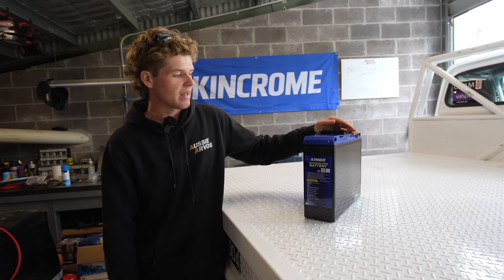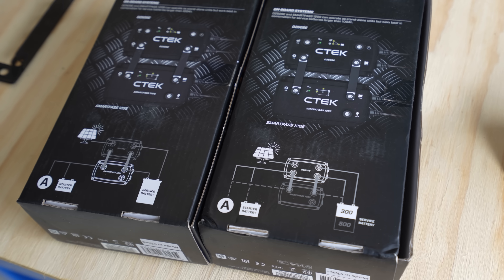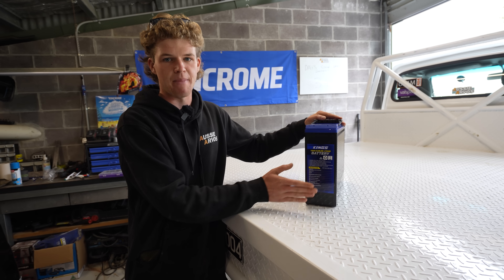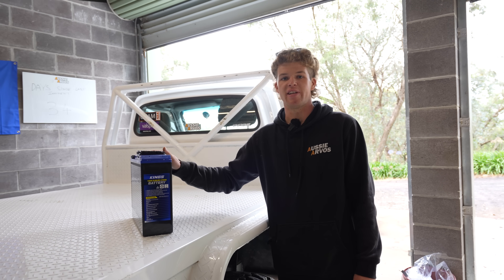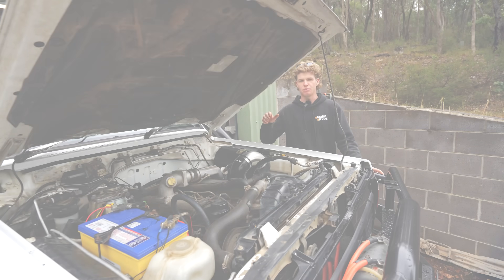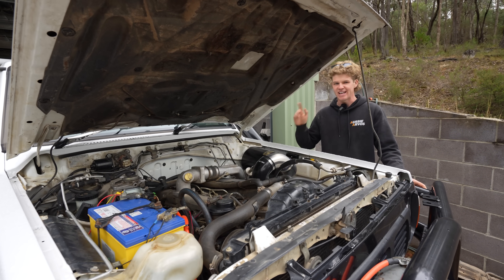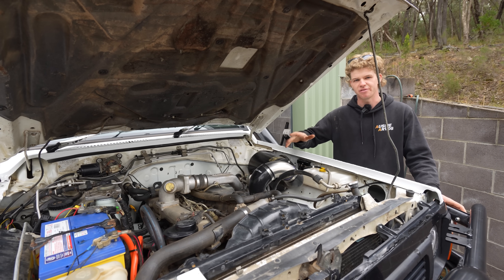We're going to fit this thing up — we've got a few more things as well, chargers and that, and some pretty cool charging systems happening too. But the first step is to figure out where this thing's actually going to mount on the car. My biggest consideration was where on earth am I going to stick this battery. My previous lead acid second battery was mounted in the engine bay, but particularly with the lithium batteries now, they're not rated for the engine bay heat — especially the King's one I've bought — so the engine bay was not going to be an option.